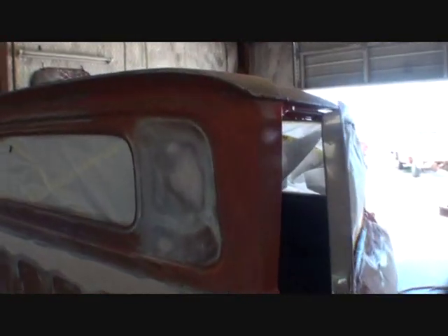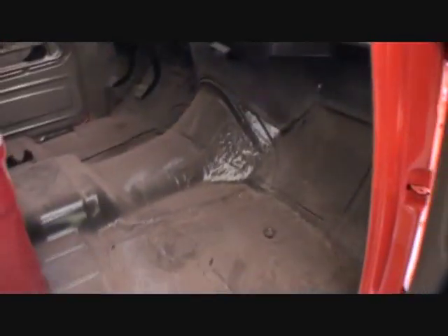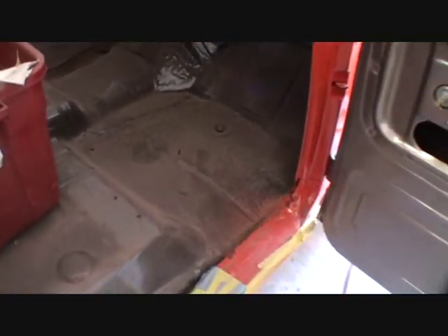This is all I've got left right here. These areas — I've got to get rid of that red paint and bring it down to the primer, then start taping it off and getting it ready for primer. As we look inside, you can see the inside of the truck has already been refinished and restored. Everything is new inside, including our gas tank. We've done all the gauges, put our heater unit back in, installed all brand new air vents and air ducts, repaired the floor using a fiberglass technique — make sure you watch those videos, that's going to save you a lot of money — and we've already got our door jambs painted and done.